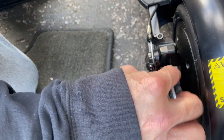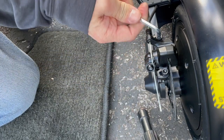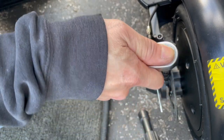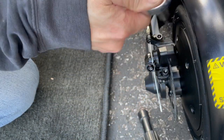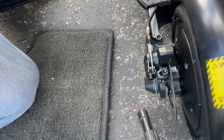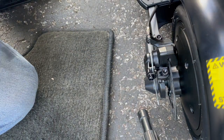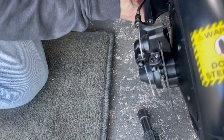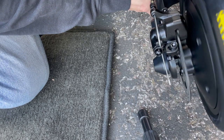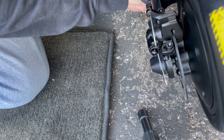As I tighten it with the brakes fully squeezed, what happens is the inside pad is going to rub. But let me try it anyway. All right — I can see the pad touching right there. Let's lift this up. Hear that? It's actually not that bad.